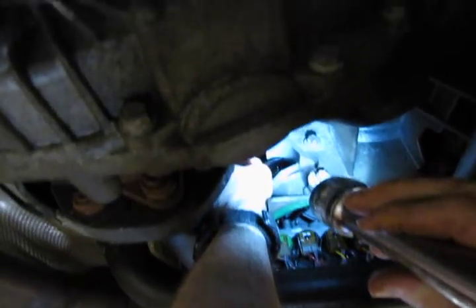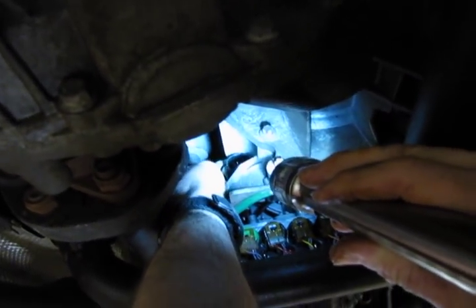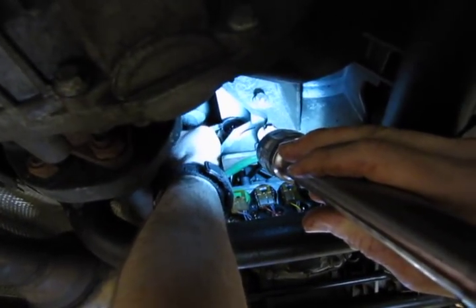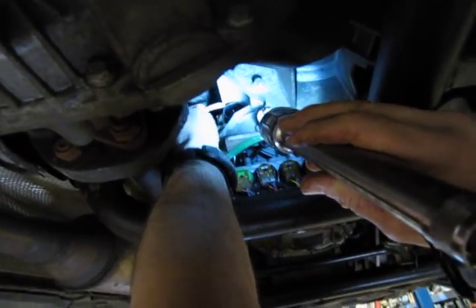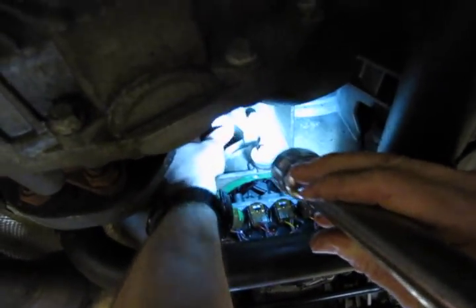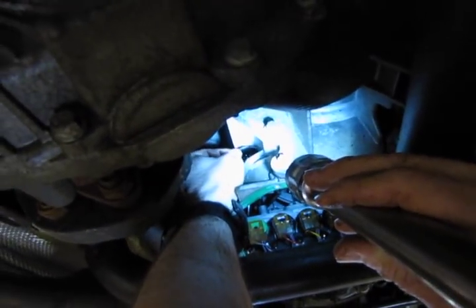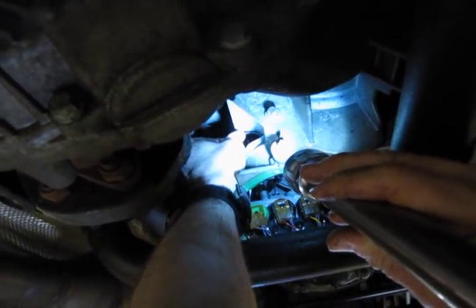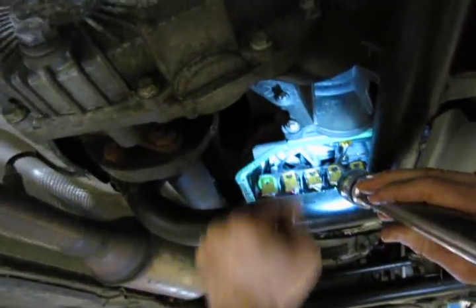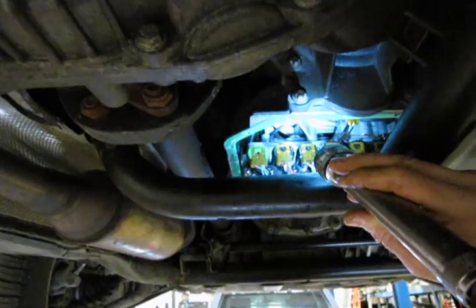You're going to find right behind the connector for the internal harness there's a slide tab — I've grabbed a 90 degree tool, you pull it out, break it loose and this slides right out from behind the connector. You can now push that connector into the transmission. You may need a small wooden block or whatnot — it'll freeze up after sitting there for several years, so just give it a tap in and then we'll simply disconnect and sneak it out through this opening on the back side of the valve body.